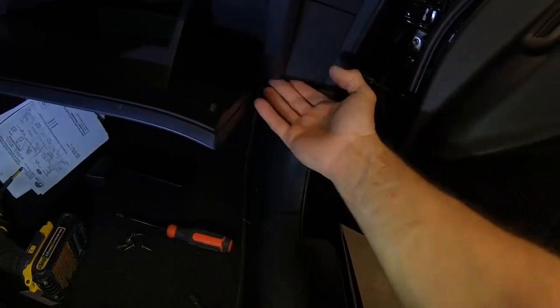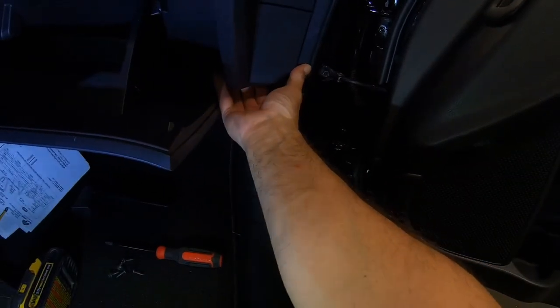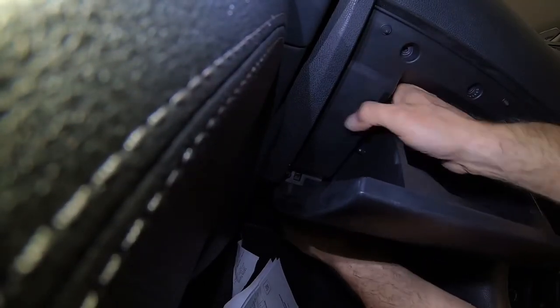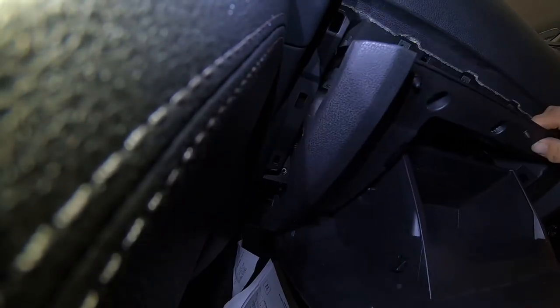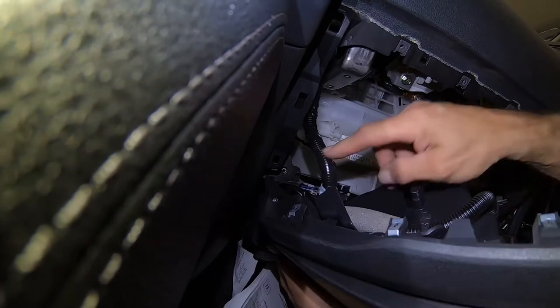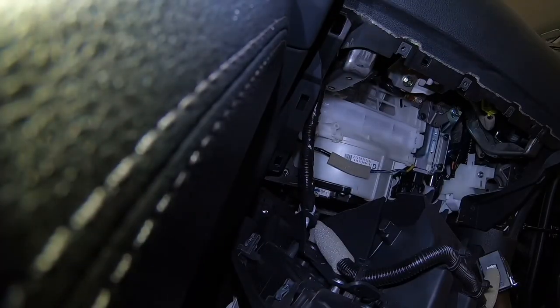That's all the screws holding your glove box together. To get this loose, I'm going to start right here because I can get my finger under this panel — pull straight back and it just pops loose. It's a two-hand operation. Grab down by the cigarette lighter and pull straight back, not left or right, and your glove box will fall down. Now watch the wiring harness on the back — don't pull anything out. That's how you get the glove box loose.